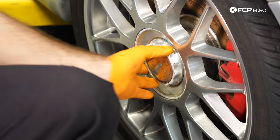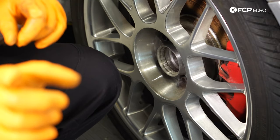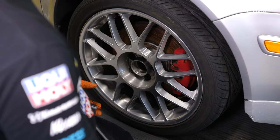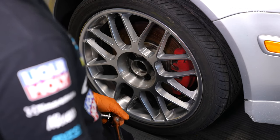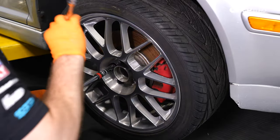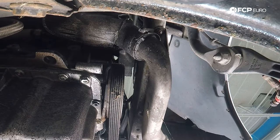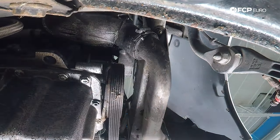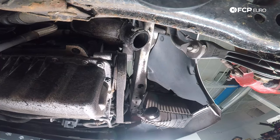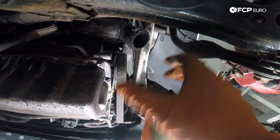Next step, we're going to want to take the wheel off. These are the factory wheels so the center cap literally just twists off. These are 17mm lug nuts, so we're going to crack these while the car is on the ground. Then you're going to want to get a jack, support the car so the wheel is jacked up off the ground, and remove the wheel. I'm on a lift so I'm just going to go ahead and lift a little bit, remove the wheel, and then we're going to go ahead and support the engine with a jack and a block of wood. We took the wheel off. We're going to be working in this general area to get access to the crankshaft pulley, so this charge pipe is going to be in the way — two 7mm hose clamps. We're just going to disconnect it.